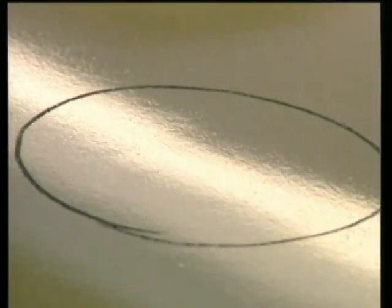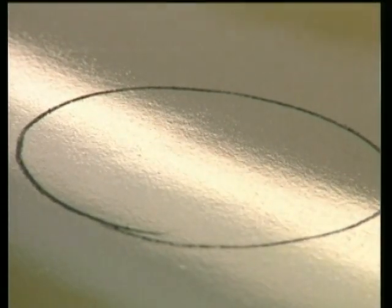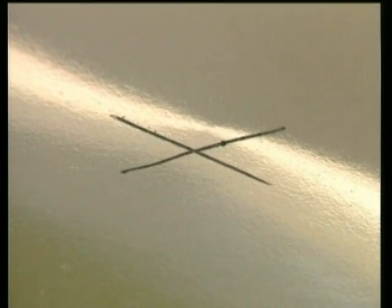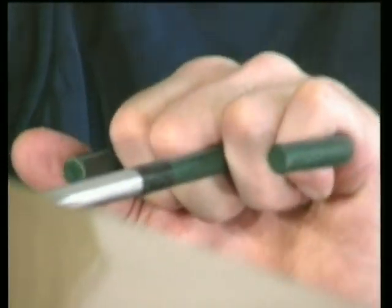Now make about 20 small circles together. Pick a circle and using the light, get the center of the tip as close to the center of the circle as you can. When you think you have found the spot, push the tip up to see the metal flex. At first you will do well just to get inside the circle, but practice will make it easier. Keep practicing until you are comfortable with tip placement. Then mark 20 or 30 crosses on a flat part of the bonnet and see if you can make a high right in the middle of each cross. When you have managed to consistently hit the center of the crosses, try the same exercise with just dots. Keep practicing until you can hit the dots with confidence and regularity. Feel free to experiment with different tools and see which is the most comfortable for you.